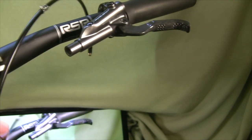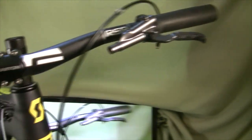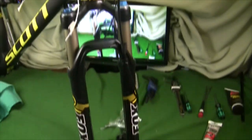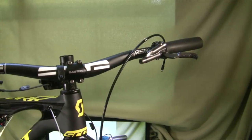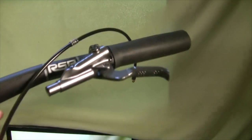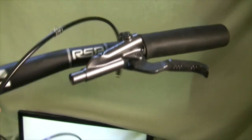I make sure I leave enough room to be able to do that in the future. The front fork is obviously a lot easier for running the tubing because the handlebars and the fork will move together. I've wrapped a little piece of paper clip around the tubing approximately where I'm going to cut it.